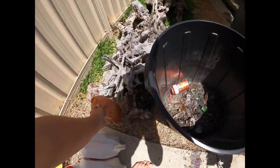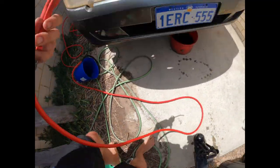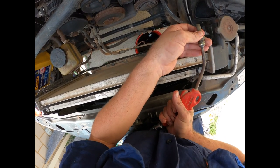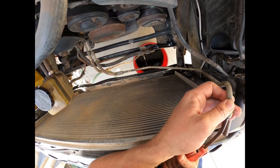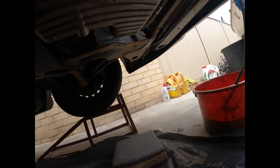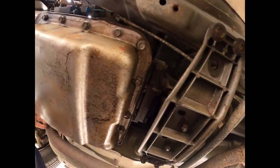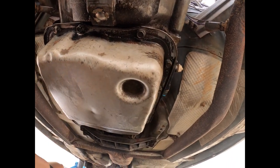That was only about four litres, so I'll let that keep draining for a bit. I'm under the car now and the next job is to take off the transmission sump pan. From memory that's one, two, three, four, five, six, seven, eight, nine, ten, eleven, twelve, thirteen, fourteen, fifteen, sixteen bolts I'm gonna have to undo, and then drop this pan — hopefully it contains the rest of the remaining fluid.